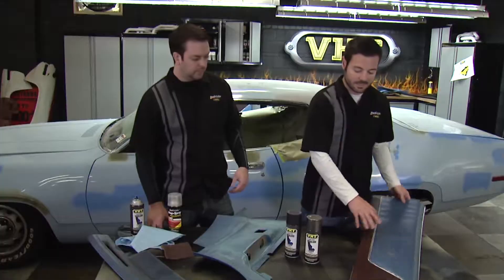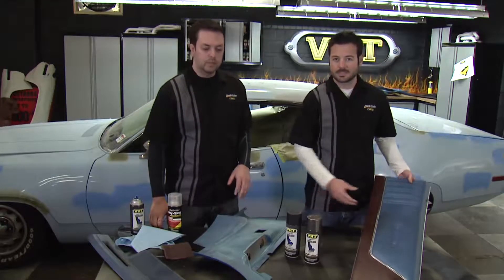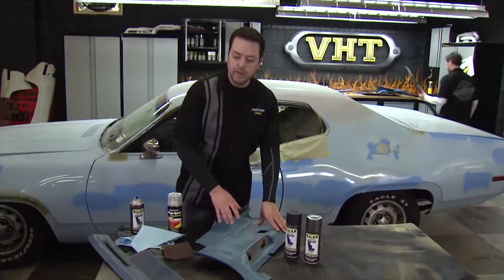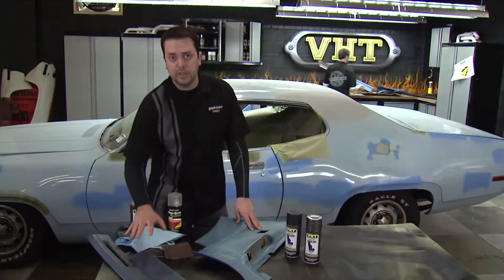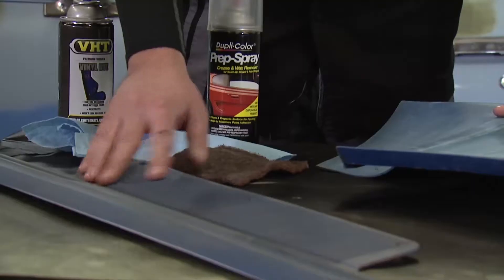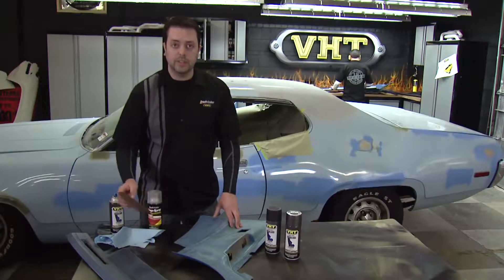We're actually going to be doing a two-tone job on this piece, and Mark can take you through how we're going to prep the rest of these. So for the inside vinyl here we're going to make sure that we prep spray these to clean them and get ready for a fresh coating. We did have one portion here where it's metal, so for this metal portion we can use VHT vinyl dye as well just to make sure the match of the finish is consistent, but we want to make sure we give this one a light scuff before we use the prep spray as well.